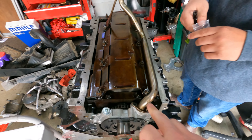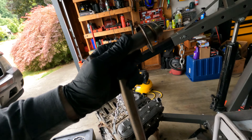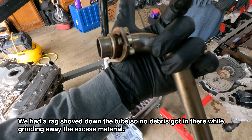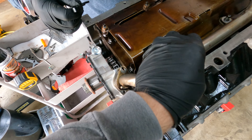So we'll take off the oil pickup tube, shove a rag in there, and just grind it off and go from there. We just took the angle grinder and removed some material there — not all the material, but just enough to clearance that. Then we sprayed some brake clean through it, used the air compressor, and cleaned it up with a rag so it's perfectly clean and there's no metal contaminants on it. I took the O-ring off for now just so we can check the fit.